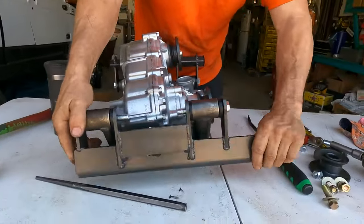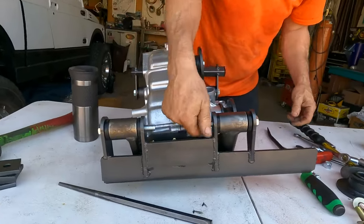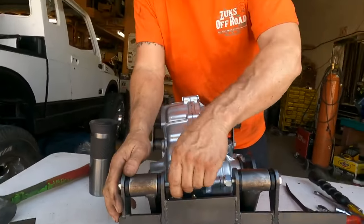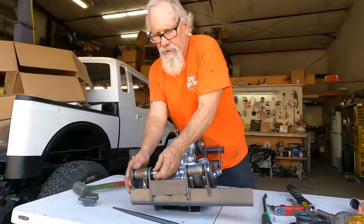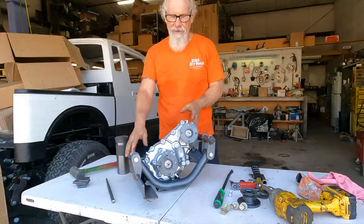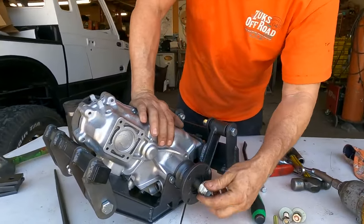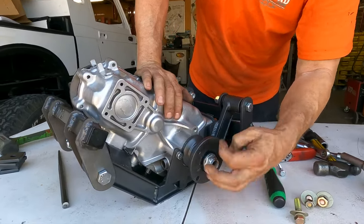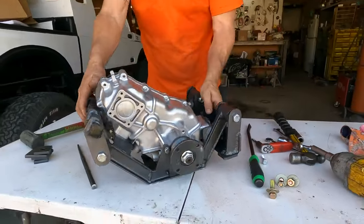As you can see, the hip also pivots a little bit. Nylocks on the inside, and you can tighten these nylocks. I just didn't want to do that on this particular install. All right, now this next phase, because we're ready to put this in the car right now. Obviously, I put the rear flange on after all my bolts are tightened. And don't forget to peen these. All right, we're ready to install it.